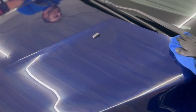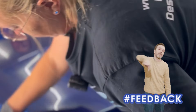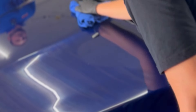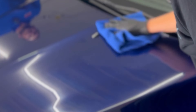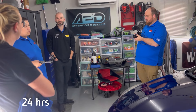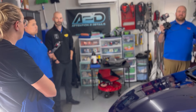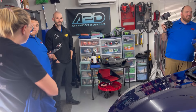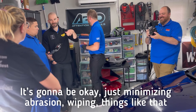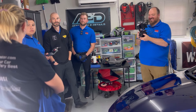I'm curious what attributes you look for in a ceramic coating, or if you've never applied one, what intimidates you most. This style is one of the least intimidating, especially for beginners, but for pros too — after a long day of polishing you just want to finish strong, and this makes the ceramic coating process so much easier. At what point is it fully locked up? 24 hours. You can release it in four hours, and if it gets dusty or pollen hits it in that first 24 hours, let it go — minimize abrasion and wiping.